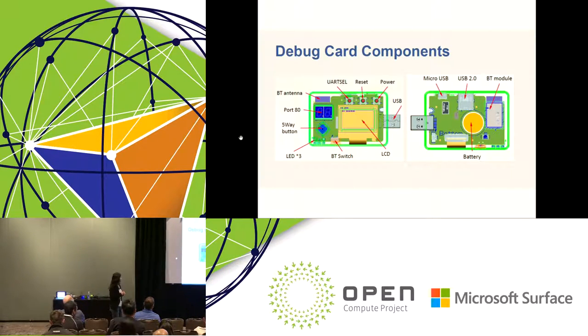On the bottom side, we have the Bluetooth module, the USB 2.0 port, and a rechargeable coin battery. The battery supports scenarios in the data center where a technician finishes servicing one server and walks to the next — the battery keeps the Bluetooth module on so you don't have to reconnect again. With a full charge, the battery can sustain two to three hours. Whenever you plug into any USB port, like your laptop, it starts charging. There is also a Bluetooth switch to turn Bluetooth on or off to save battery.